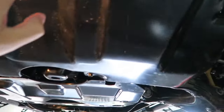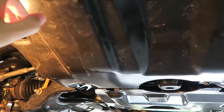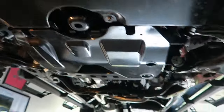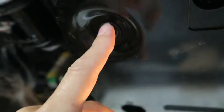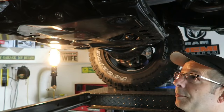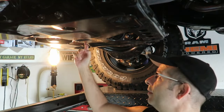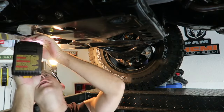This is going to replace this thin — look how thin this thing is — skid plate that's on the front. We've only got four bolts: two here in the front and two here in the back to remove. And then to get the rear skid plate off, we've got a bolt up in here, a bolt up in here, and then these two bolts back here. I believe these two bolts back here need to be reused; everything else will be replaced by bolts that came with the new skid plate. First up, I'm going to remove the rear skid plate — it takes a 12 millimeter socket. Four bolts: here, here, up in this indentation here, and up in here. We're going to start with the most difficult ones to get to. You can't really see them in there.